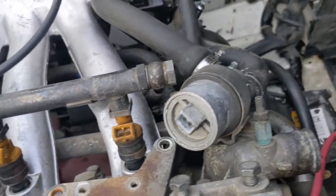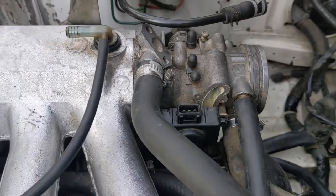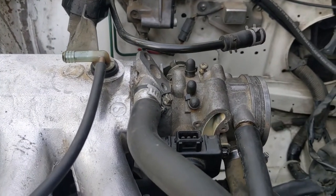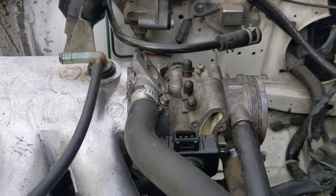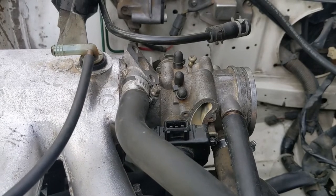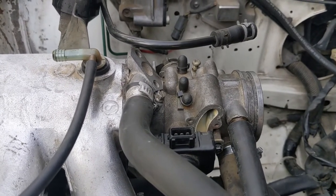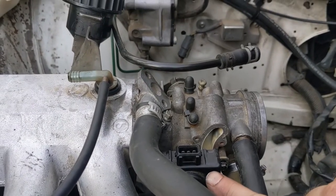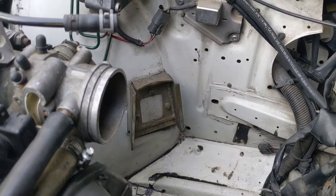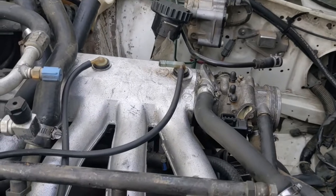One thing to call out on this car: you'll notice a little ravine right here. On these cars the coolant runs through the throttle body — I took that out several months ago for lots of reasons, hopefully all good ones, none of them performance related. That whole 'take the coolant out of the throttle body to gain 50 horsepower' is an urban myth. You'll also have the connector on the throttle position sensor. The air mass meter connector we already undid when we removed the air box. That's about it for the fuel injection harness.